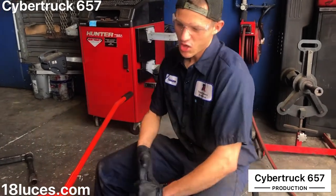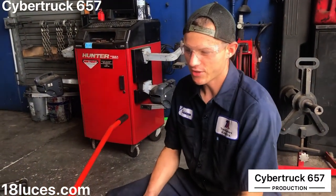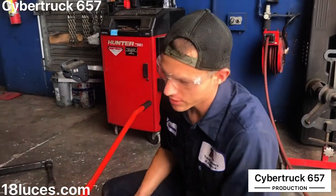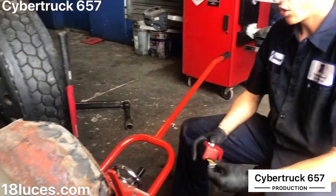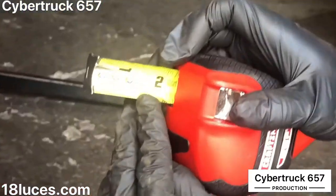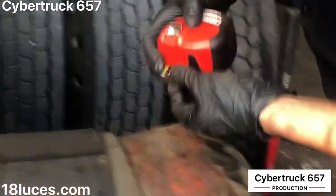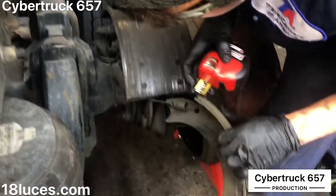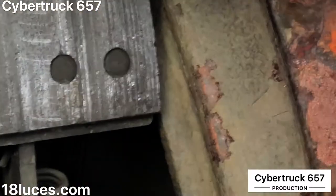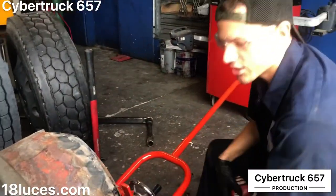What we've got going on here today is we're doing a brake job. He wanted to make sure he would stay within the DOT regulation limit. For those of you who don't know, the minimum DOT thickness for your pads is around a quarter of an inch. His brake pads right now — you can measure and see — they're at a quarter of an inch, and that's your minimum point from your brake shoes.